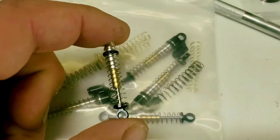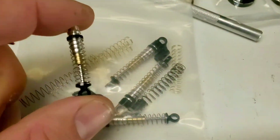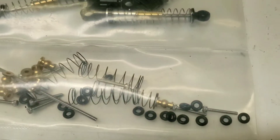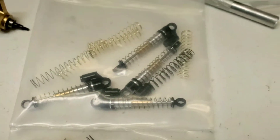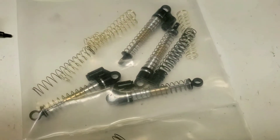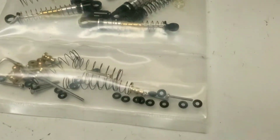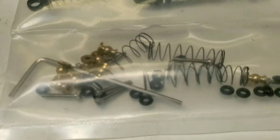When you lift up, the spring will no longer be touching the top when you articulate. Some of you like to run a full droop setup with no spring at all — this would be preferred over that, as you still get some spring action but with much better droop. It comes with three regular spring sets: very light, medium-light, and slightly firm. It also comes with brass shock balls instead of steel or aluminum.